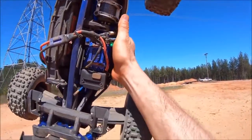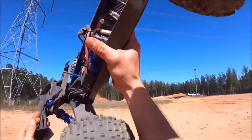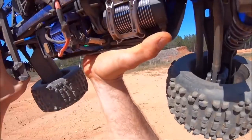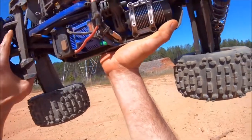Guys, I'm not a huge fan of this motor mount at all. Luckily M2C is going to be designing a whole new mount for this. I'm not a real big fan of adjusting from the bottom — it's just really hard to set a perfect mesh. You want a nice slide up top that you can really get it honed in nice. I got a chipped tooth on my spur gear because the motor mount shifted, and I chipped off a couple of teeth on the spur.